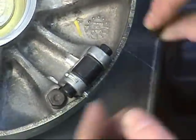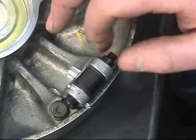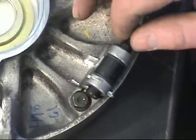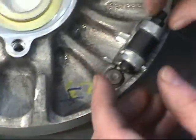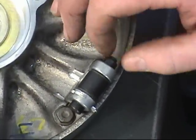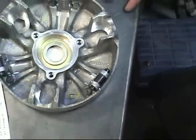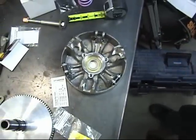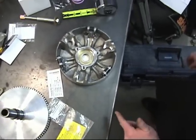I think I mentioned before, this portion of the calibration is for a driver who is about 180 to 230 pounds. And if you are more than that, actually it's just good to start off with this pin weight, even if you're heavier or lighter, so that when you go test at full throttle, let the tachometer tell you what amount of grams you have to put in, if you have to put in any at all. So flyweight determines RPMs, right? And 1/2 gram is equal to 100 RPM.